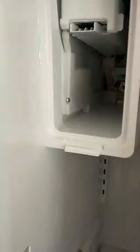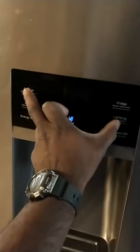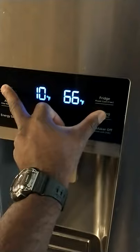All right, everything's back in, the screw back on the side, the plug's back in. Now it's ready to plug in. There's a 7-minute delay on these Samsungs. So what I do is I plug it in. I let the thing run its course. Then I just do my little FF this time. Not RD, but FF. I hold it down. 1001, 1002. LF5.